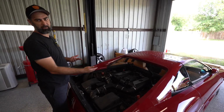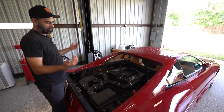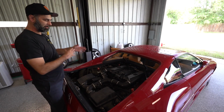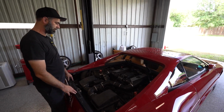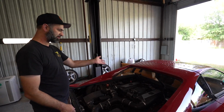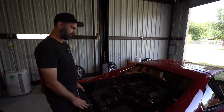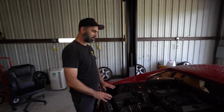You've got a bad coolant temp sensor that's forcing it full rich, and it can't compensate with lambda sensor values, so you can get some cascading things there. So you don't want to just assume that all those faults mean all those sensors need to be replaced. So we'll want to go through the engine management system and pin out each and every sensor and see if anything is very clearly not within electrical specification.